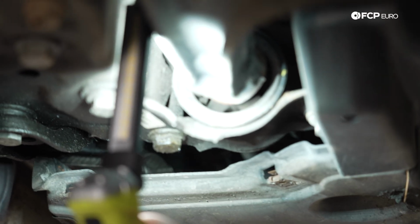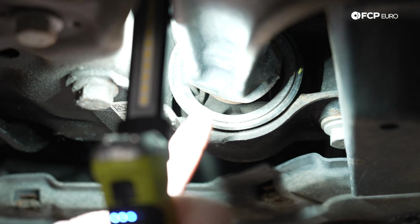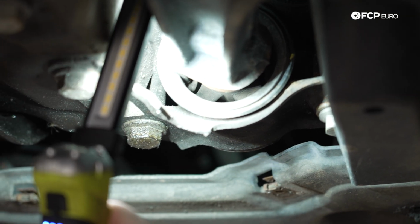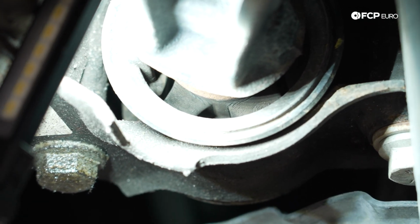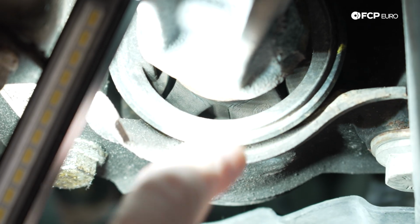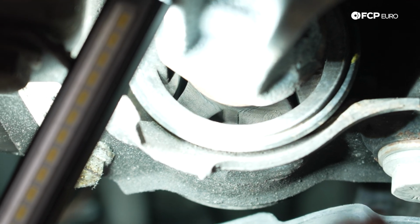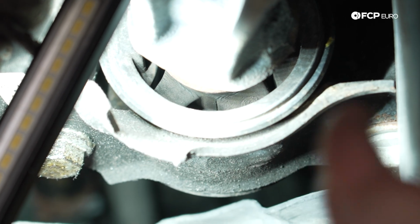So yeah, looking back at these control arm bushings, just looking at it right here without putting any pressure on it, you can see a lot of stress cracks and wear on the bushing itself that I mentioned. As that thing twists, it's just going to fail. And once it fails and starts to loosen up, and you can see a really heavy tear on the right-hand side there, once that tears and loosens up, that's going to allow the wheel and the suspension arm to move back and forth this way, and the whole tire is going to be changing toe.